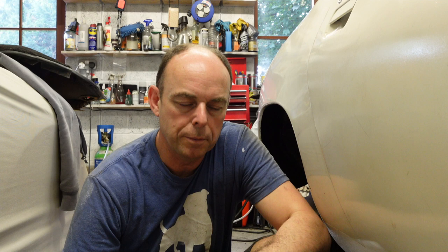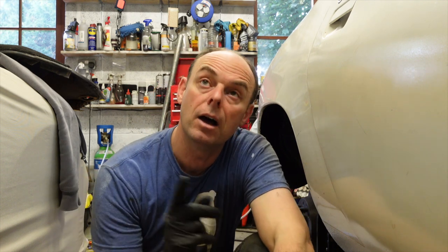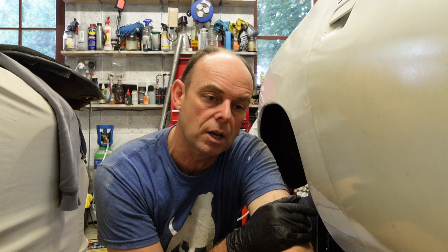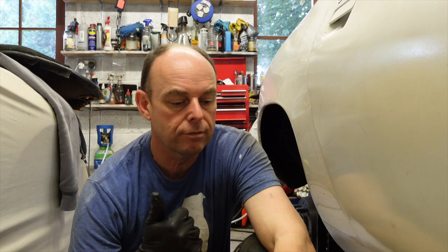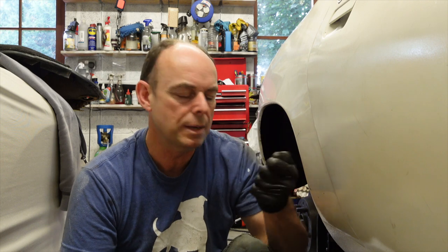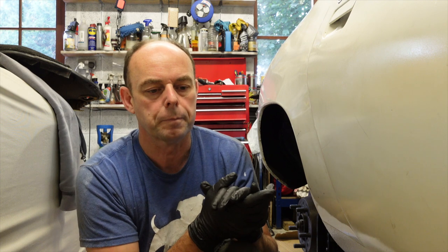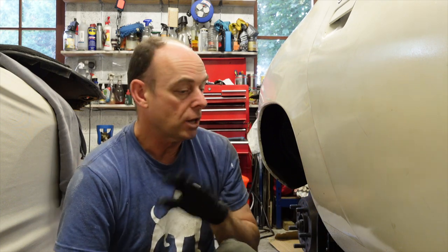Right, I've spent another 20 minutes, half an hour under there, really wobbling the exhaust like crazy. And I can see one of the heat shields is touching it a little bit. And then there's that oil return pipe for the gearbox that could have been tapping on the underside as well. So I've secured the pipeline. I've rejigged all of the heat shields so they can't move around. I've used a metal zip tie to hold one of them down because there is nothing nearby to bolt it to. If it proves to be a problem, I'm gonna have to make a bracket and run it across about 6 inches or so, just to get that secure. But it can't rattle now.